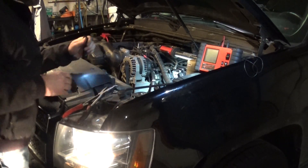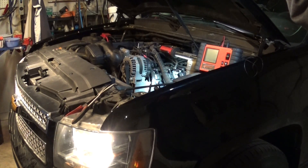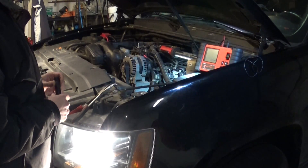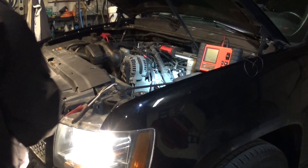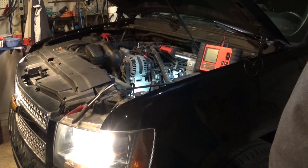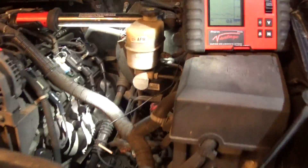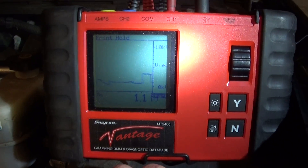I'm putting my clamp on the swapped wire, starting it up to see what happens. We still have misfire on number five — the misfire did not move. This is my histogram now on cylinder three — this is the wire I moved from cylinder five, and I put it back on number three. It seems better on three.